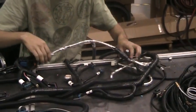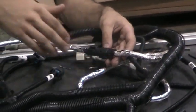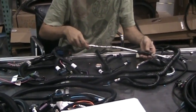It's not going to have this plug here. You're going to want to cut this wire around 4 or 5 inches from the edge here, then we're going to add this Molex connector in here.